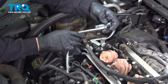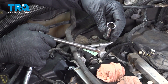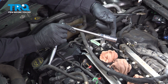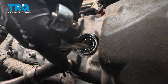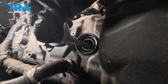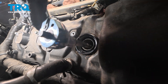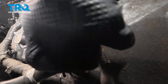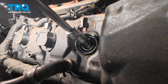Now we're going to use a 16mm spark plug socket and a 6-inch extension with your ratchet. The spark plug socket has a rubber grommet inside to hold and capture the spark plug. Drop this down inside — you can hear it pop on — get that ratchet on there. That spark plug feels quite a bit tighter than it should be. Once it feels pretty loose, pop the ratchet off and spin that extension to remove the spark plug. There it is — there is your spark plug.